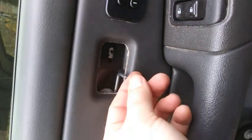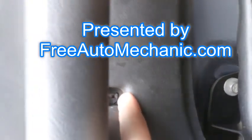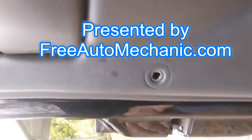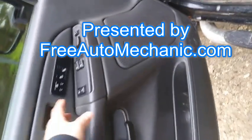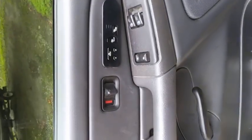You'll notice the holes line up. If they don't line up perfectly, then you need to reconfigure it and slide the notches back inside the door so it sits right. Make sure that your door lock rod moves freely still and let your bolt holes line up properly. Then of course on the back you've got your three bolts. Put your covers back on, and on the handle — trim piece. Get your trim panel back on.